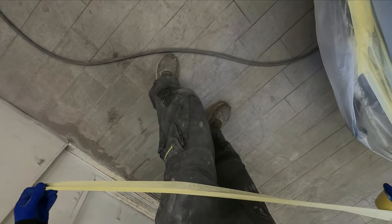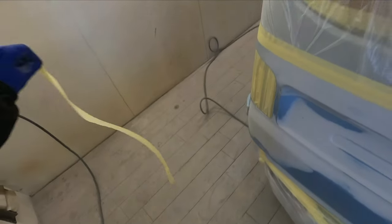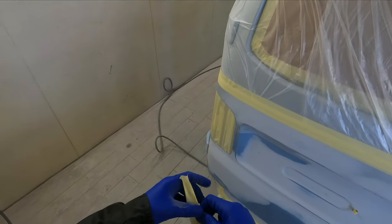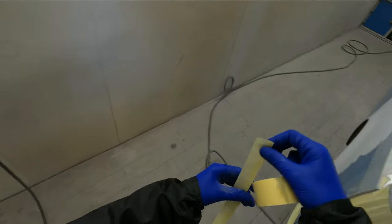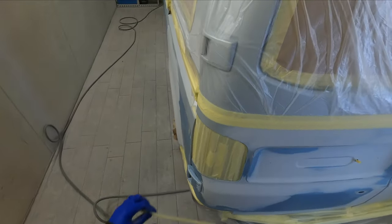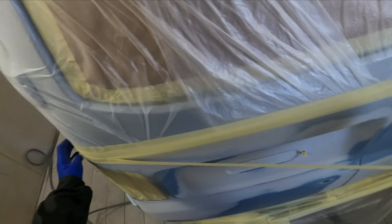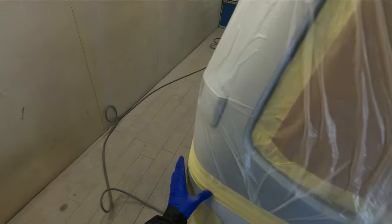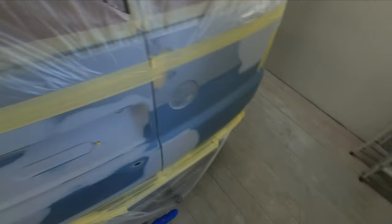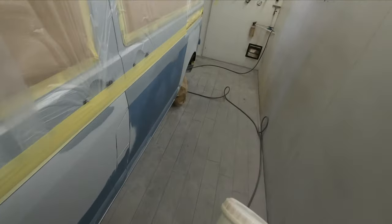Now on the back end I'm just going to use a tiny little bit of false edge masking to do pretty much the exact same thing. I don't want a very hard thick edge there because I don't want to have to block this edge out after. And where the join in these back doors comes, it will be higher than it originally was because where this van was originally painted to was quite a strange height for where you'd normally paint one of these T5s. Also it was like two or three colours at the bottom and now we're just going for this one uniform colour.